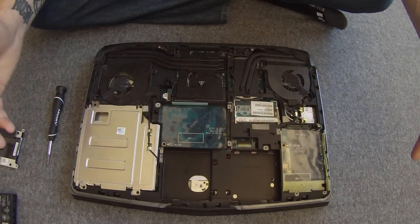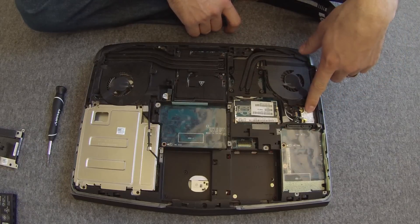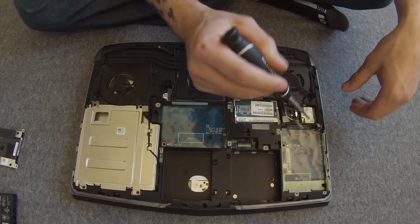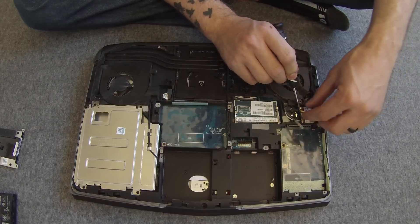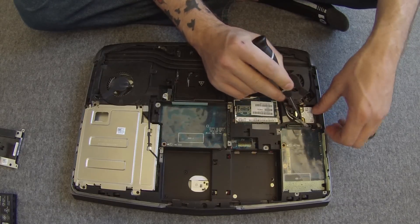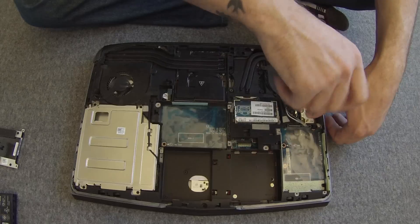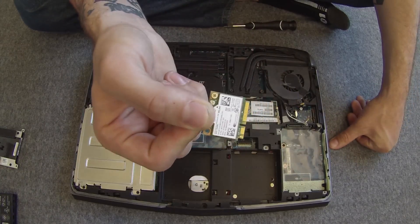My games stay on the solid-state drive, which is the Corsair Force GS — I had that in the Y510P as well. It is a SATA 3, 6 gigabit per second SSD. For the Wi-Fi card, you do not need to remove it to take apart the laptop, but I'll show you anyway. It is the same as any other laptop — just pull up on one cable, then pull up on the other cable. There is one screw; remove that, it comes up at a slight angle, and then you remove it.